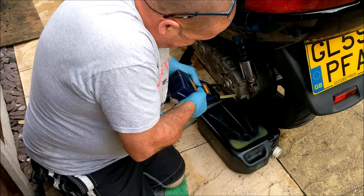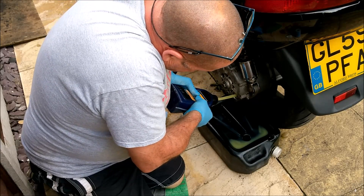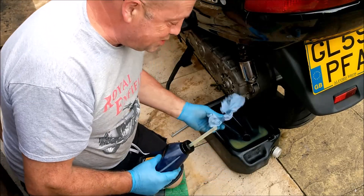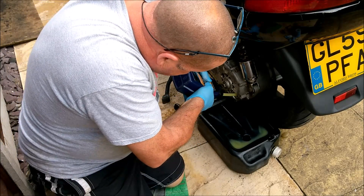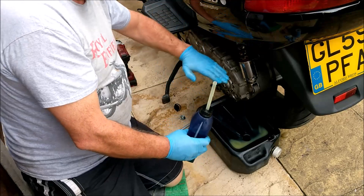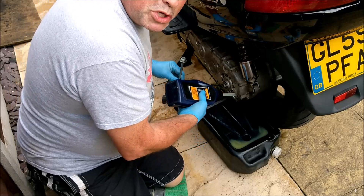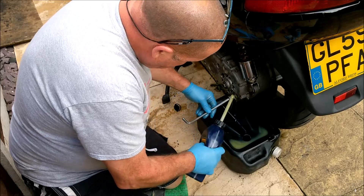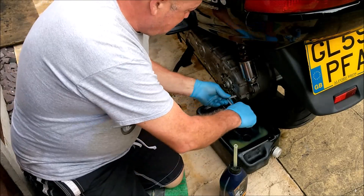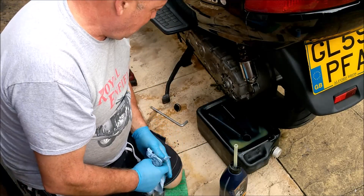It's my favourite job this. We have some oozing going on. You see the colour is transparent, it's not milky going in - it's definitely something else. The reason being is the bike is actually on a slope, so when the bike gets up on a level that level is going to drop. I need to really get this ready on the end of my tool, squirt some more juice in the hole, and when it starts pouring out whack it in. I think that's enough. Right, let's pinch that up. Job done again - that's the third time. Third drain and third refill.